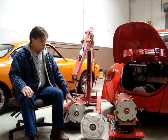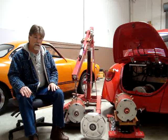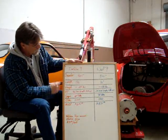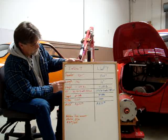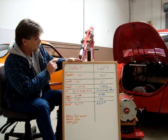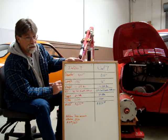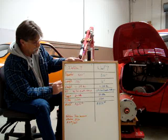Let's discuss some of those differences before we move on to the adapter. Here we have the Impulse and Warp side by side — they're both nine and a quarter inch motors, so the biggest difference is the length. The Impulse 9 is 13 and a half inches; the Warp 9 is 16 inches. That's enough that you have to cut sheet metal in order to get the Warp 9 to fit, and we choose not to cut the sheet metal. Cutting the sheet metal also affects the latching setup for the deck lid, so that's not an option we like.